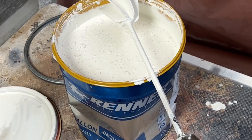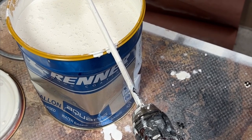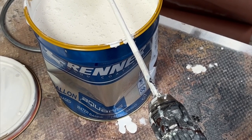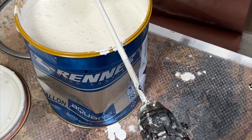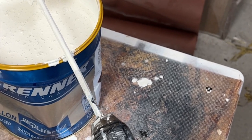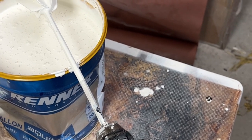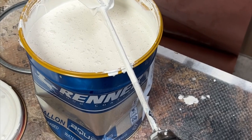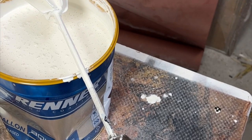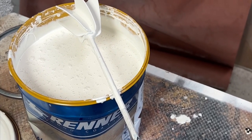If you have your paint in a garage on the floor, I don't care if the air temperature is 70 degrees — if it's down on the floor, your fluid temperature is probably down in the 60s. The easiest way to get it up to temperature is to keep it on a shelf in a warm place or put it in a bucket of warm water for a while to let it warm up. You don't want it overly warm because that's going to kick off the catalyst too fast. Keep your fluid in the 70 to 80 degree range and it's going to atomize and flow a lot better.